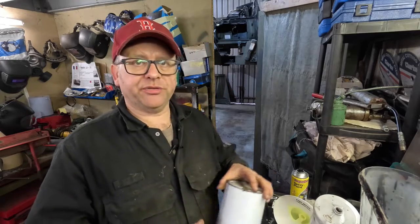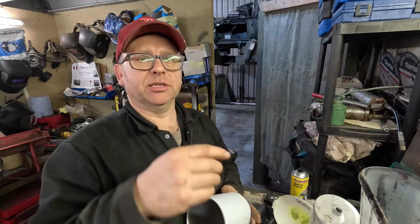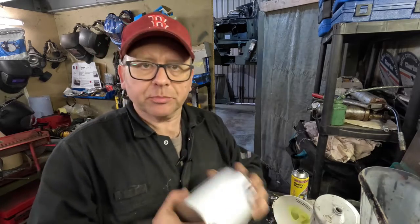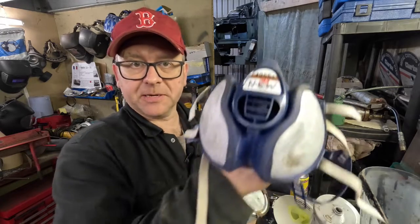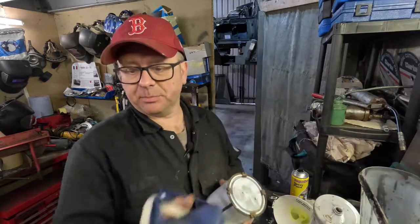So to start off, because of the facilities we've got here, I always use cellulose. That's sometimes described as 1 pack, and then you get 2 pack, which needs a hardener and then a thinner as well. But we're not doing that because that needs protective equipment. I can get away with spraying the 1 pack here in a well ventilated area to make sure my eyes are covered, because you can ingest the paint through your eyes, and a good 3M mask will suffice for this.